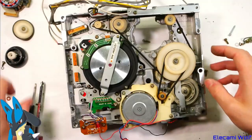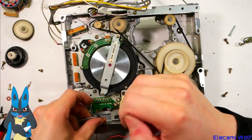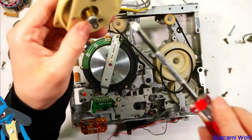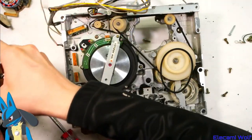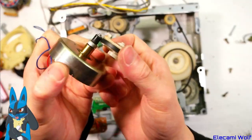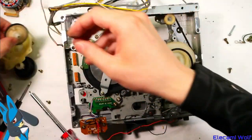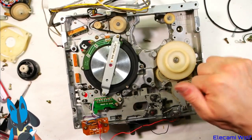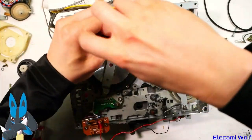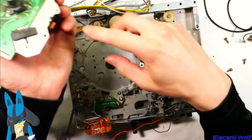The pinch roller is not the best — it's got a shiny bit on it. The capstan is in okay condition. The capstan motor is one of those real big ones — older style. The mode switch goes up to a connector so it can be replaced as one piece. There's the reel motor — an interesting pancake style motor. It's probably been through a few of these in its life, but I don't think this has been replaced.